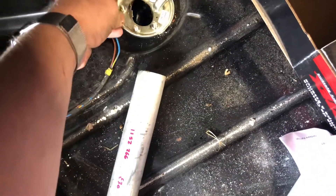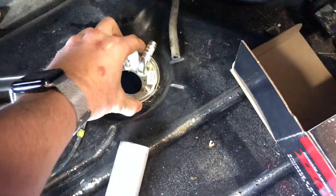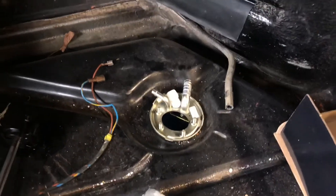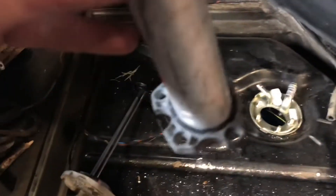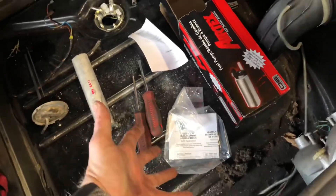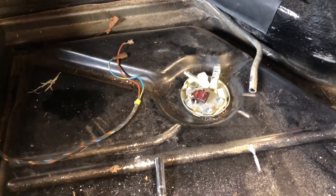This tank is so full of gas — it's ridiculous. I actually think I want to put it in one notch more that way. Those brand new O-rings are pretty stiff, but it's looking good. I think I can make this routing work and I'm probably going to use this for the return — it's not ideal, but it fits pretty well. I'm going to pick the old gasket out and install the fresh new one. That old O-ring was super flat, still sealed just fine, but since we have all the new stuff I'm going to do that up a little — eight millimeters — just make sure your nut and washer are good. That old gasket was quite well perished, so this should be pretty good.